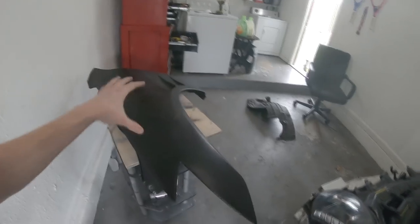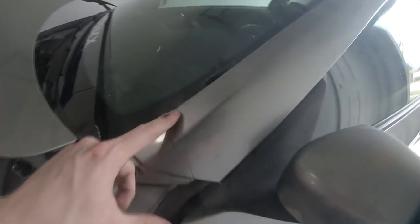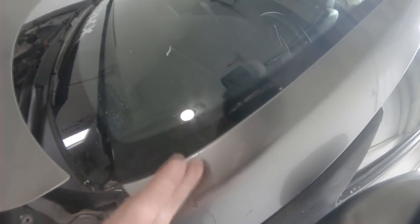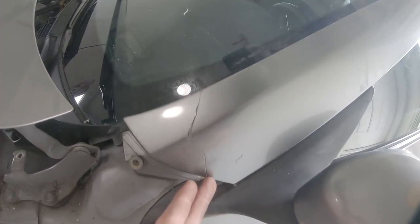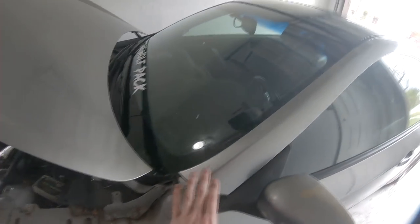The fender is all mocked up and everything is looking really good — all the bolts are drilled. There's just one little piece over here on the A-pillar I want to focus on: there's a big ugly crack in there. I want to bring the same approach I did with the front bumper — drill a pathway right through the crack, fill it with Bondo filler, sand everything down, make it nice and smooth, and it'll look good with a dip coat over it.